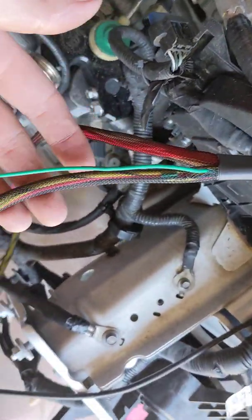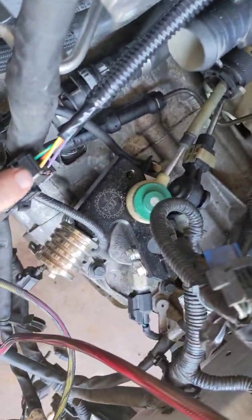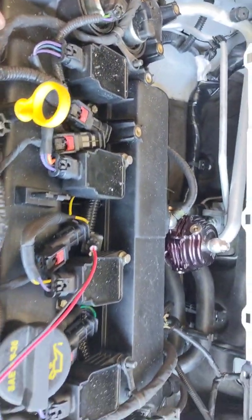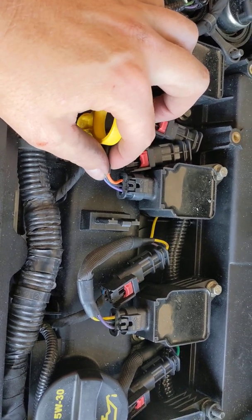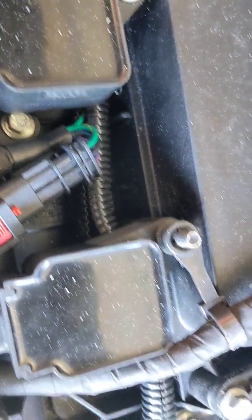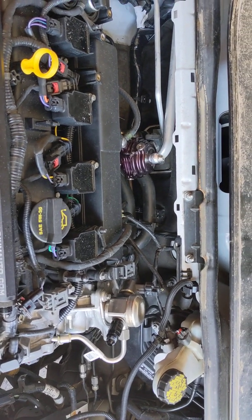Ordinarily this wire is wired into the yellow and black harness that goes over this way. You can see where I loomed and taped it up, and I've got mine routed underneath the ignition coils — that's actually going to be our power and ground there. It's a little cleaner looking doing it this way. We've got the harness adapter from Speed Performance so everything was plug and play. We tried to hide the harness the best we could. There's a lot of space underneath the ignition coils between the coil and the valve cover. When you back up and look at it, you really can't tell what's going on — it looks stock. I like the low-key incognito look.